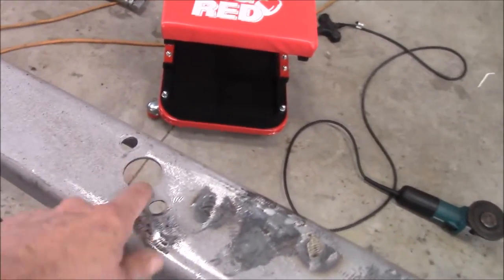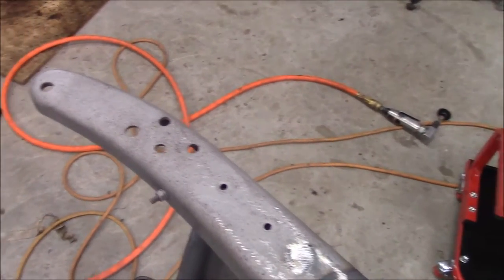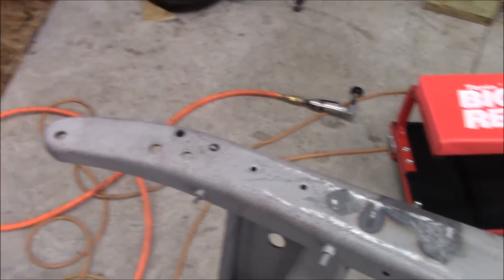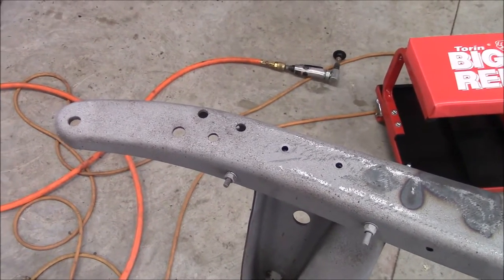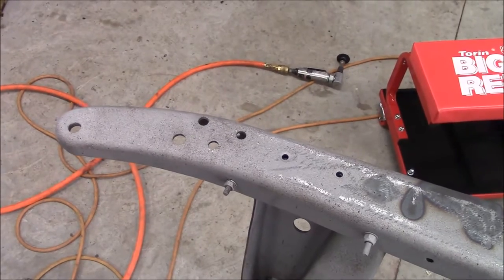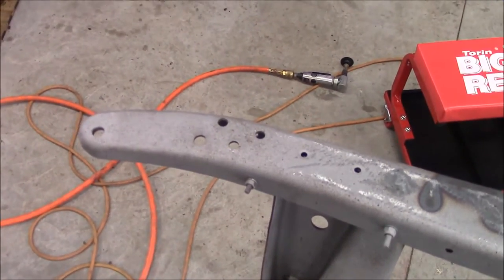That's where the steering box is going to come out — the steering shaft. I still have to work on the frame horns here at some point. I think the frame got hit sideways with the bumper on it, kind of bent the frame horns a little bit. It's not too bad but it's noticeable, so I'm going to try to bend them back, maybe just by heating. I hope I don't have to cut them, bend them, and then weld them, but we'll see how that goes.